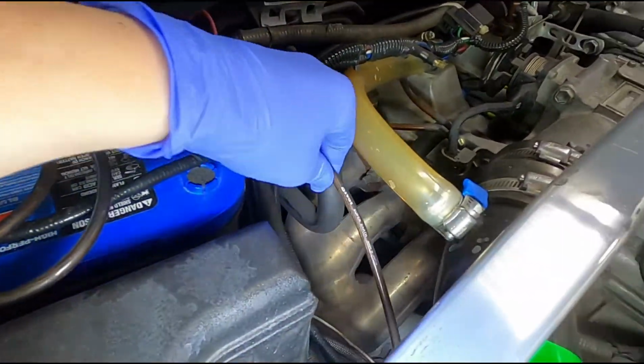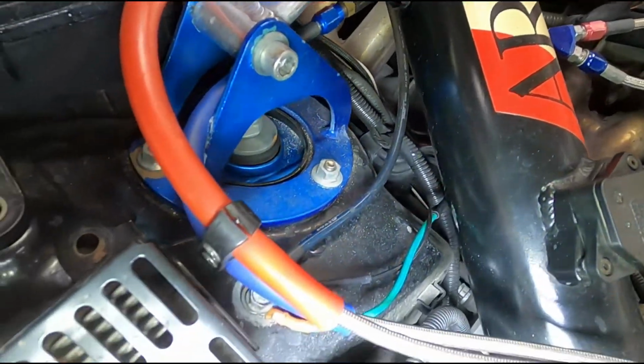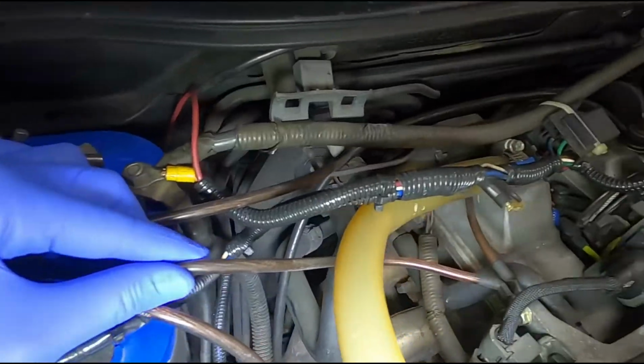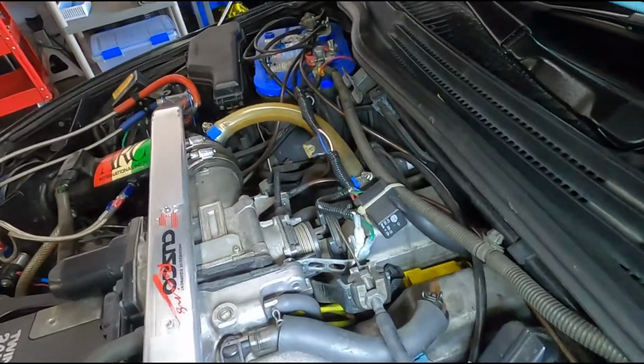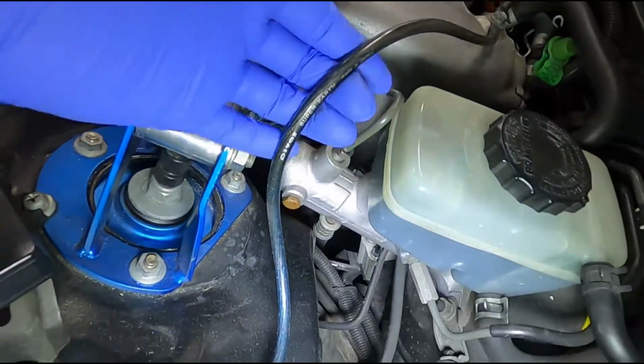Now, it's important to note that the car's battery acts as its own voltage stabilizer, and here's how it works. Electricity is created by the alternator and used to power the car's electrical demands: lights, stereo, AC, etc. Any unused charge created by the alternator is then stored in the car's battery. This is why we say the alternator charges the battery.